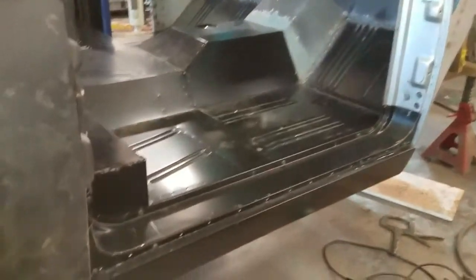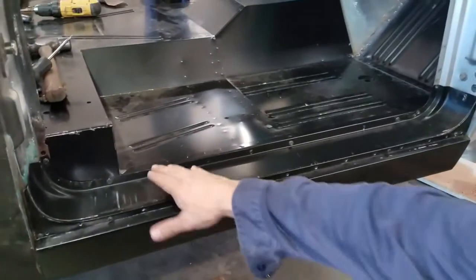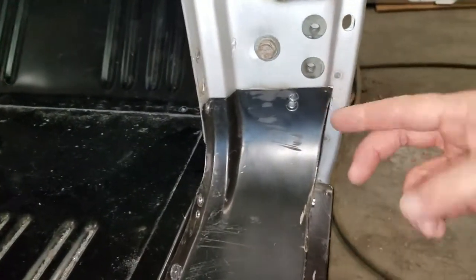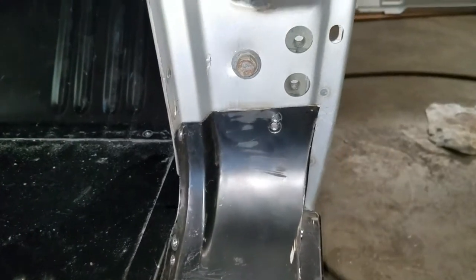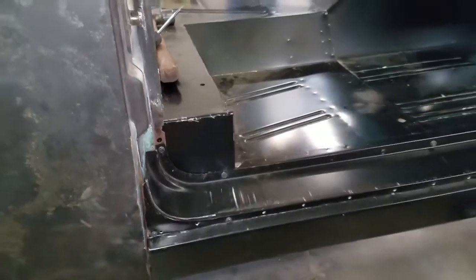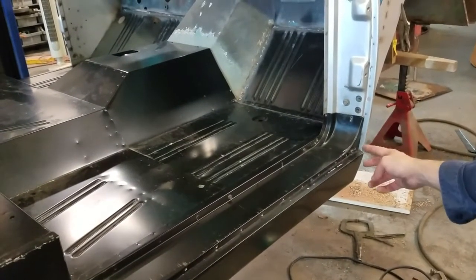It's on. I've got some screws in it. Just want you guys to sort of see the pre-fit. Straight across the top, we're really snug up against the A-pillar there. I still need to trim right along in here and then weld that back up. I can't do the back side yet because I'm going to replace the B-pillars too. As far as measurements, everything went in. I'm a little tight down here and it's a little concerning to me where your fender rolls by.